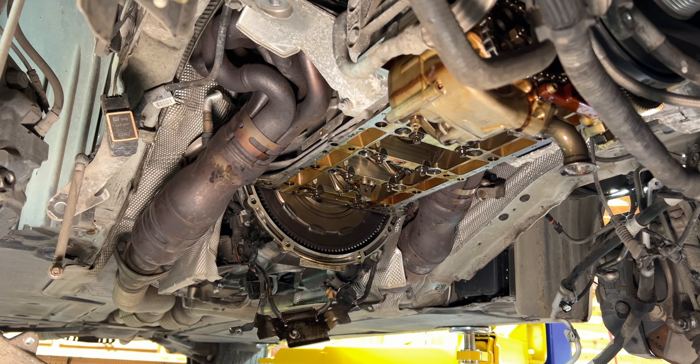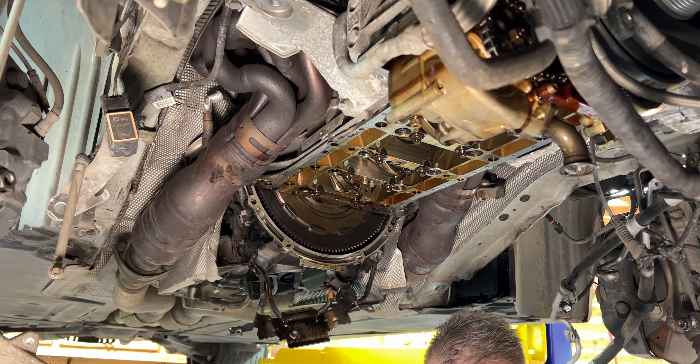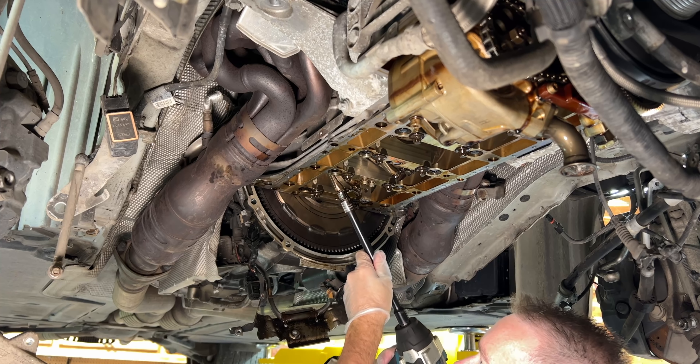Last night I got a link and took one of the loose ones apart — it looked very odd, I'm not going to show you that right now. We're going to go ahead and take them apart from number 10 cylinder down to number one. The VANOS pump and everything seems really good. There are a lot of bolts on this engine you basically cannot put back the way the factory put them in, and these were all perfect. We're taking each one out and not replacing anything yet until we see all of them.